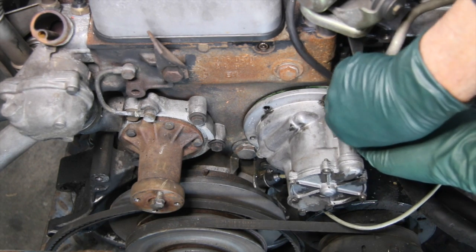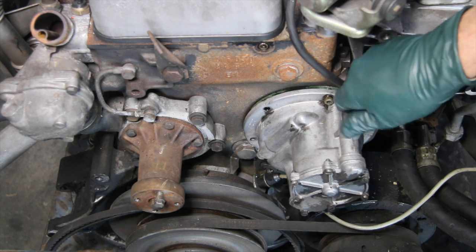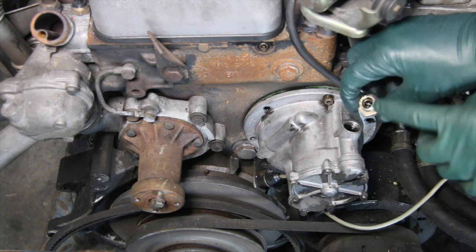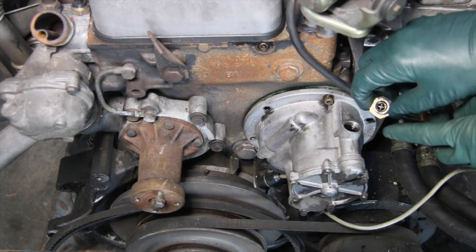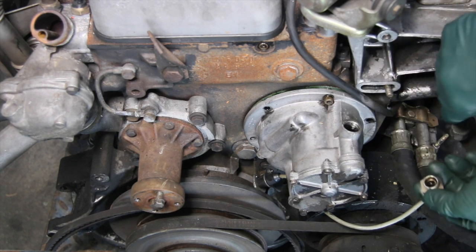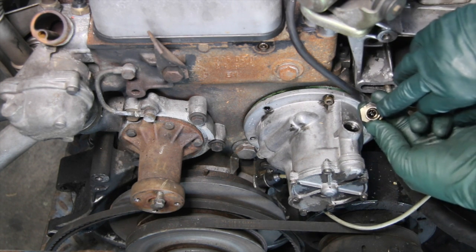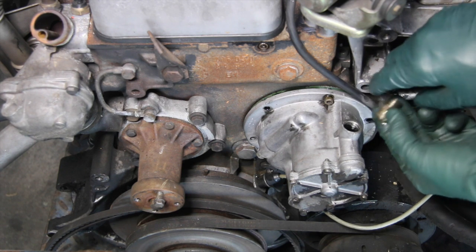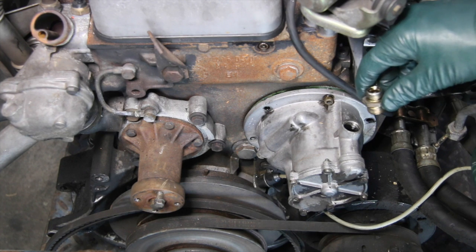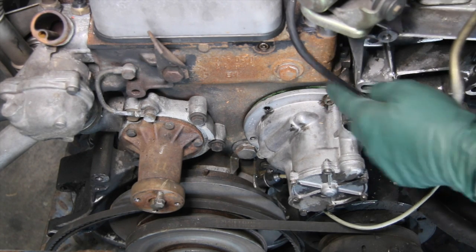These pumps have what's called an external check valve, located on the outlet line at the top of the pump. This is replaceable without taking the pump off the engine. When this check valve fails, you'll have to brake very hard, your door locks won't work, and any other vacuum-related things on your car will stop working. Usually what happens is it just comes apart internally. Take this line off, look down in the hole — if you don't see the little X or check valve down in there, it's gone and you'll need to replace it. These aren't inexpensive new, but we do carry these used on my website.